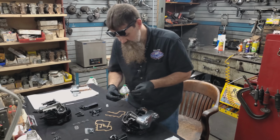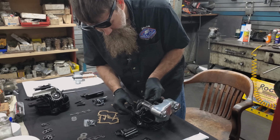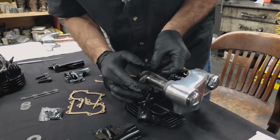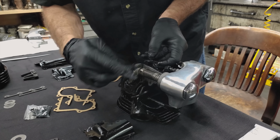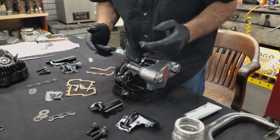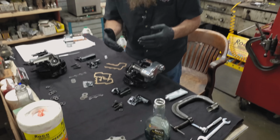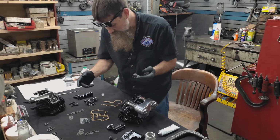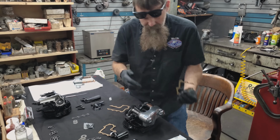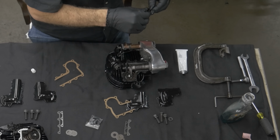Now, the cups themselves, you'll notice there's a top and a bottom. These are the oil cups. They actually allow the oil to collect around the valve spring that's sprayed in through the rocker arm and rocker arm shaft. Each of these cups and their tops have been fitted long before we bolt the engine together. So as this stuff comes together, it's incredibly important that it all fits perfectly. Remember, you've got pressurized oil to the top end.